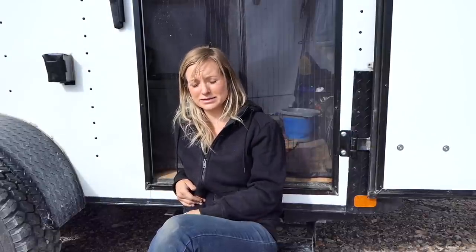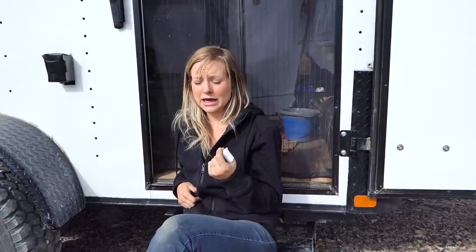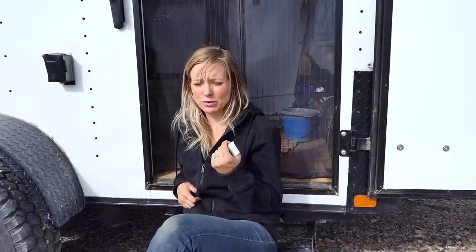On a lucky note, if you remember back in summer I helped Robert reinstall a diesel heater into his van. He kept a whole bunch of old parts to harvest for spares because these things are known to have issues. He had an extra fuel filter, so we swapped out the fuel filter and the fuel pump I had ordered online, and now it seems to be running just fine.